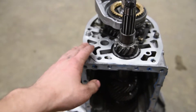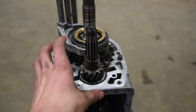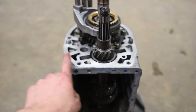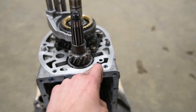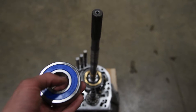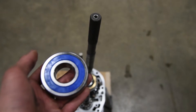Just remember when you are putting it back together, clean all these surfaces. I also decided to remove the bottom piece of the housing — I figured while the bolts were already out it had enough time to flex and move around, so I wanted to take it off, clean the surface, and put RTV on it. Don't put too much — just flatten it out with your finger, get a nice even coat, and make sure there's no oil between that sealing surface. When you go to install the bearings, find a piece of tubing that's the same diameter as the inside race and use that to knock it onto the transmission shaft. Never press on the outer area — you will ruin the bearing.